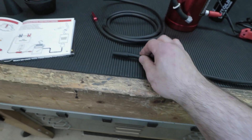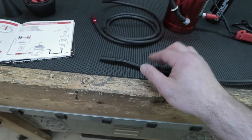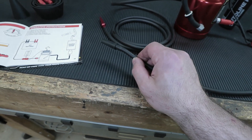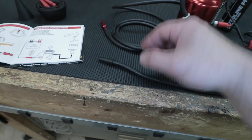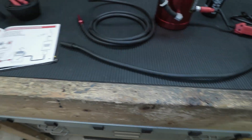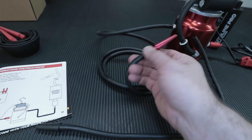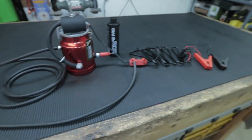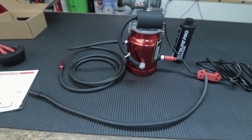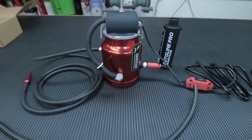I went ahead and made this adapter because I'm actually going to hook it up right at the purge solenoid. I took the purge solenoid off and this adapter is going to go inside the evap tube that's remaining at the green clip, and then I will hook up this red nozzle on this end just like that and feed in the smoke. I'm going to go ahead now and quickly pour in the fluid and show you what the internals of this unit look like.